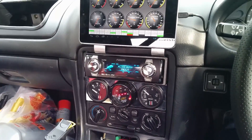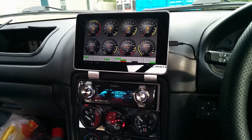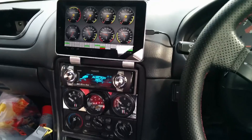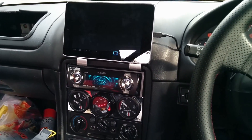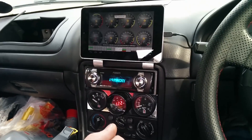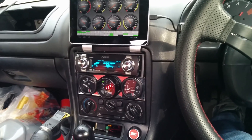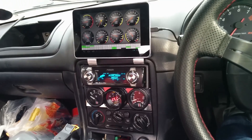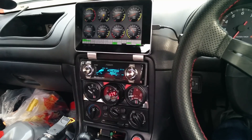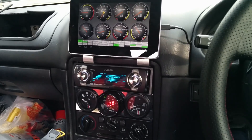I'll possibly clean up and add a little capacitor to it or something. The app is all connected now, but as soon as you turn the car on, you have to excuse an unfinished start-up tune. The tablet goes into standby mode as soon as it loses power on the key, but it aborts it when it gets the power back. I think having a capacitor in-line just after the 12 volt will hold it enough on the power so it doesn't go into that abort mode — but it's not really an issue for me at the moment.